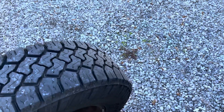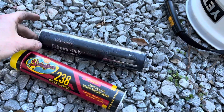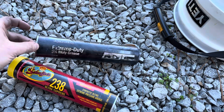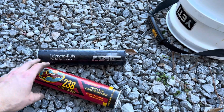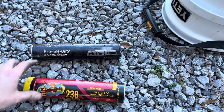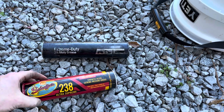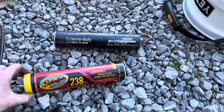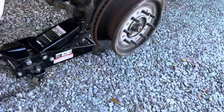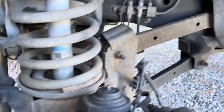When you get tires that are like this you eventually start feeling a little vibration, a little wobbliness going down the highway — I was starting to get that. I've got the grease gun out here because it's good to grease up your front end while the tires are off. This is what I usually use — Traveler Moly, black tube, it's got the semi truck and heavy equipment on it. I've used the purple as well which has the pickup truck on it, but I believe the black is better. You can get it at Tractor Supply. It's a really good quality product — very water resistant and good for high temperature, won't pound out. This is going to be a treat for the front end. Aftermarket suspension usually has a lot of grease points: ball joints, tie rod ends, even sway bar end links.